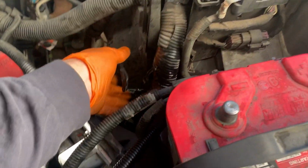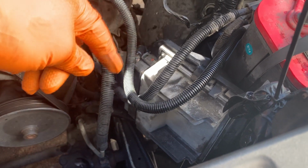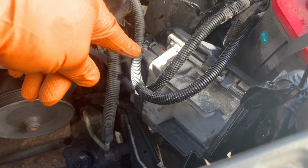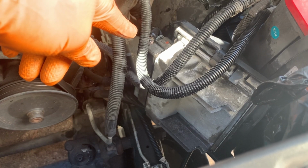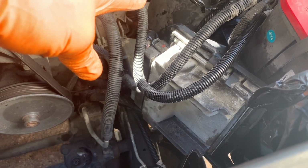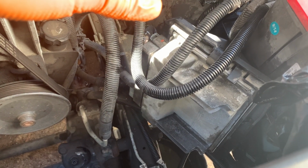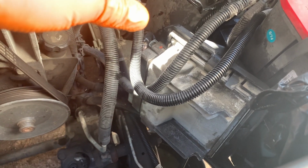And to me, that's the hard part, or the scary part, messing with the connectors there. If you're gonna mess something up, that would be the worst possible scenario, to bend a pin or something on the ECM, the PCM. So just be real careful when you put those connectors on. Make sure you tighten them down straight. Don't get them cocked to one side or anything. Double, triple check to make sure you don't end up bending a pin, or have it not inserted quite correctly. It shouldn't be too easy to mess up, so just take care and take your time.